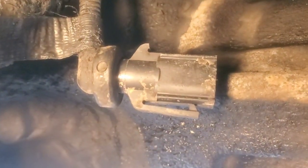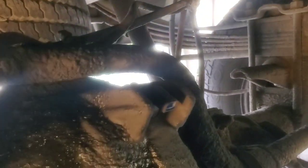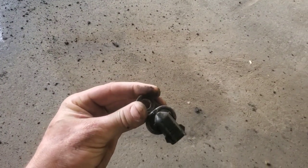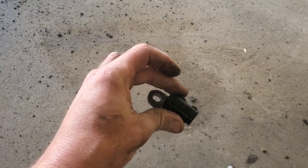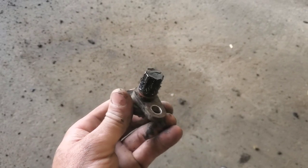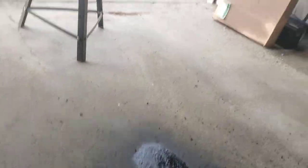You can see the plug a little better — one of the ears is broken off, but it should be okay. You can probably find a replacement somewhere. Sometimes they're kind of stuck in there, but most times not too bad. If you just move it back and forth — sometimes you might need pliers — it'll eventually come out. What's usually stuck is that O-ring. The sensor is open, so it's no good.